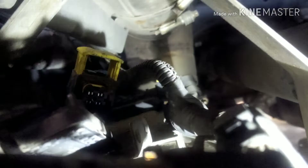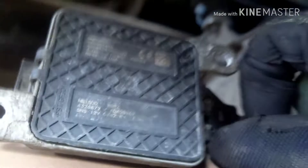It'll be sitting where this yellow connector is — that yellow connector. So you're gonna take off this thing. You're gonna need to take this off because this is a cover. And this right here is your outlet temperature sensor for the NOx. So there you go — switch them out, clear codes, let's go.